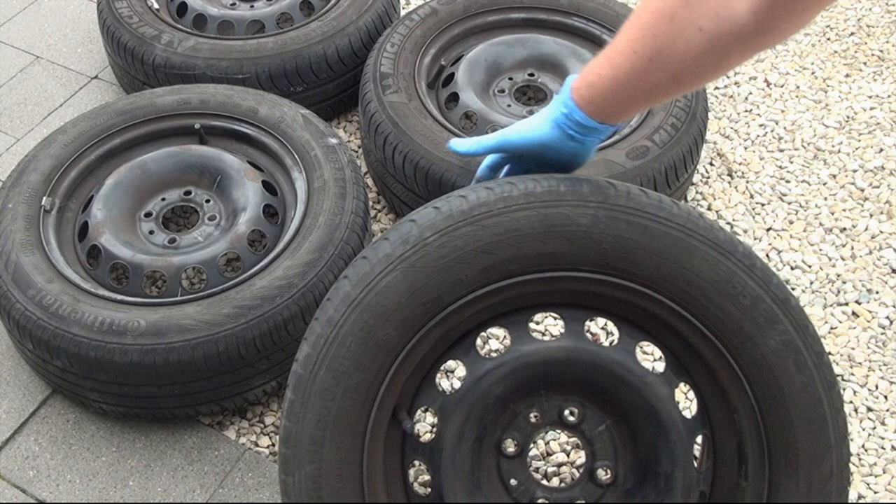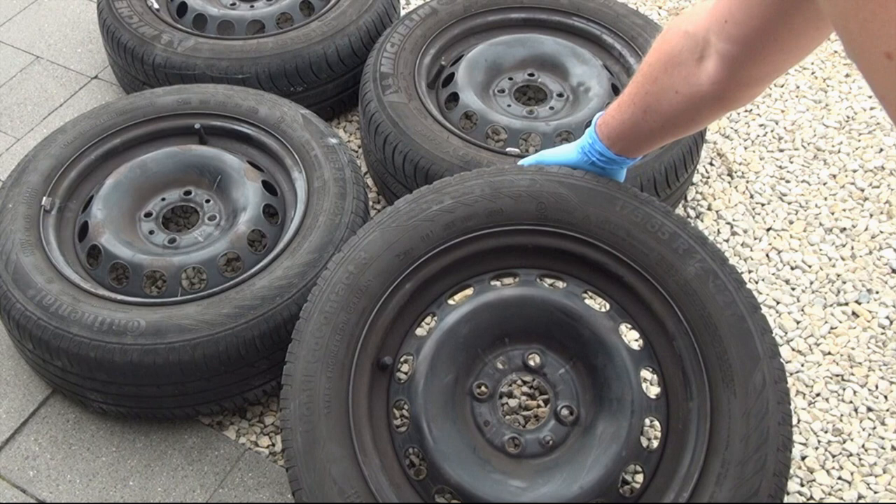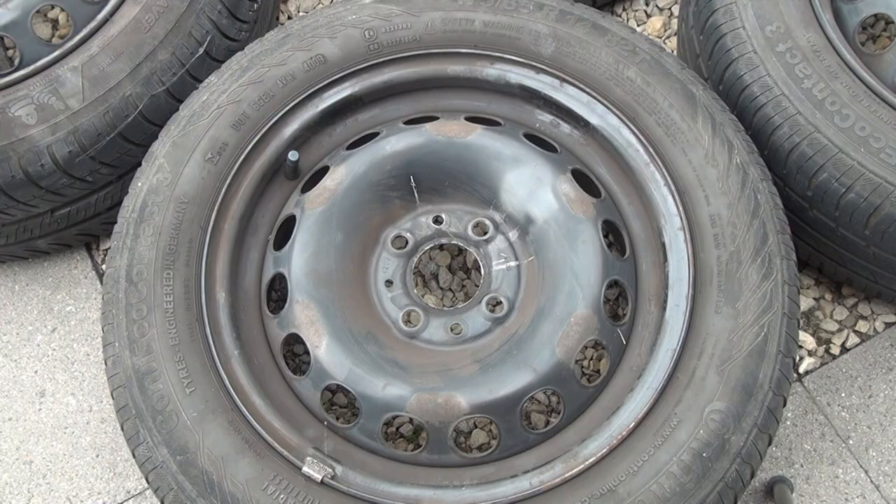You can also inspect the production date of the tire. In this case it is on the shoulder and it says 09, which means it was produced in 2009 — so they are almost 10 years old. I won't save these tires; they will go to the junkyard.